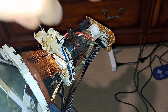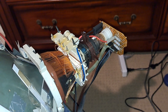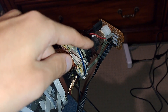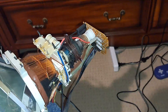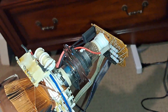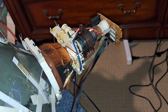We're back around to the back of the board where the neck board is right here. Something to note about some of these Orion sets is there's a little bit of confusion around scan velocity modulation on certain models. What I'm talking about is stuff like the 20AF44 and 20AF45 — both of those have a setup where there's another little plug that sits on the neck board and runs to the bottom of this yoke right here where you see these two prongs. These two prongs are supposed to have another board attached that runs to the neck board, and that is your scan velocity modulation plug.